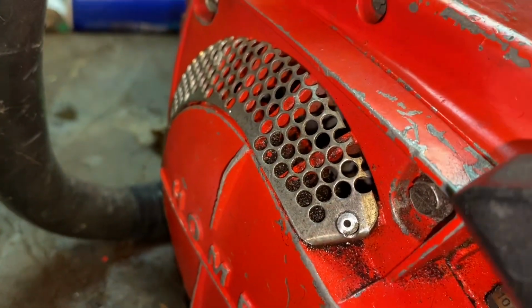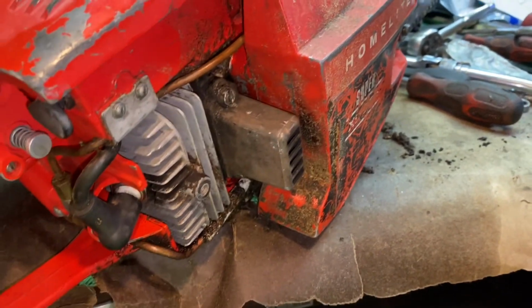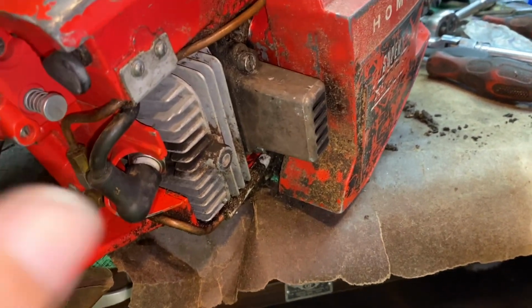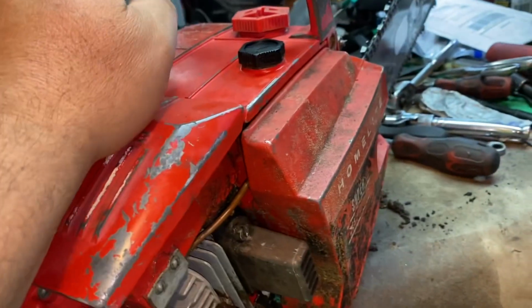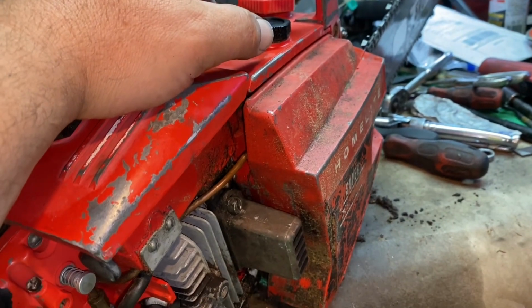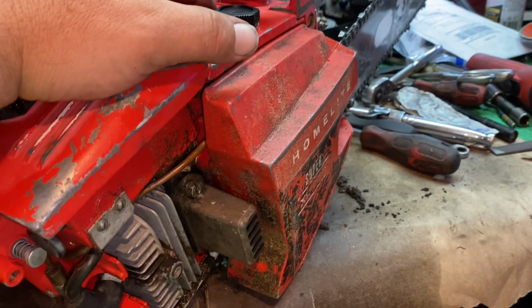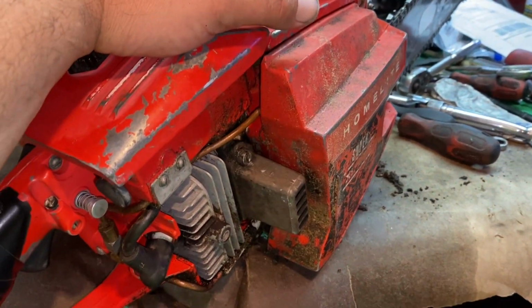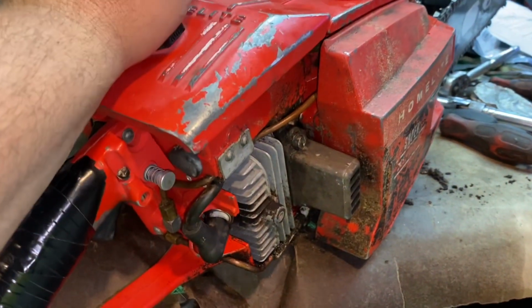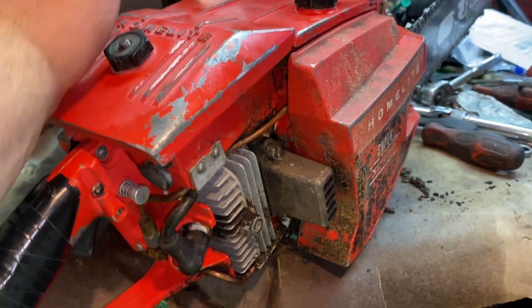There's only one time that I've actually got this saw hot, and that's because I was putting some alcohol in the fuel, and that caused an issue. So the only time this saw has gotten hot on me, running one full tank of gas all the way start to finish, is whenever I was starting to put alcohol in with the fuel mix to try to get more performance. So I actually think because I'm spinning more RPM, the saw is drawing more air and helping it cool down. But I don't think it's that alone.